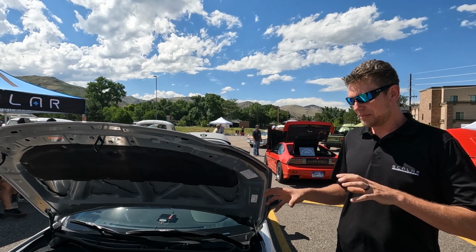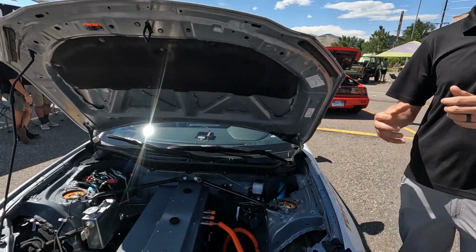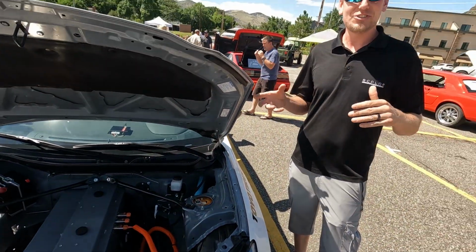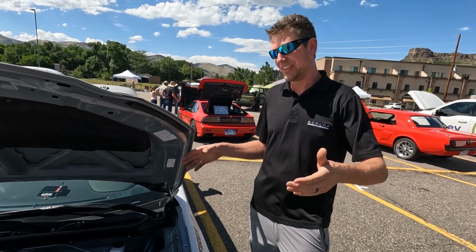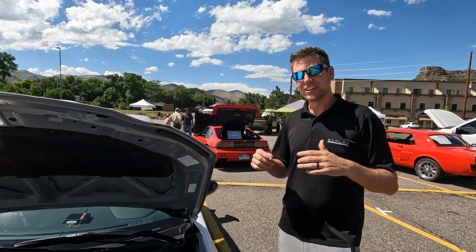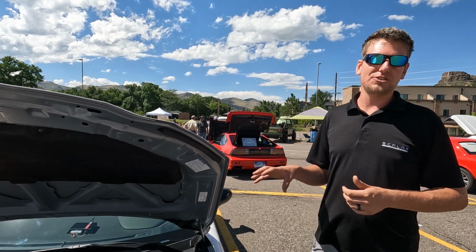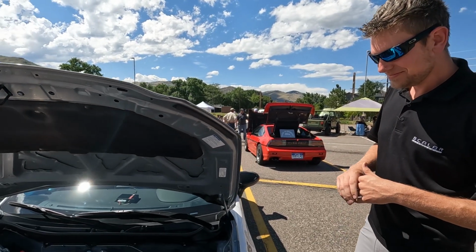It was a bit of a challenge because 800 volt is so new. For example, our DC to DC: there are tons of 400 volt DC to DCs that you can get, but try and find somebody who makes an 800 volt DC to DC. It was super hard to find. We had a big wait time to get it. The entire time we were building the car, the DC to DC was the last component that we could get. Luckily, Cascadia made inverters that handled up to 800 volt. There were some challenges with choosing 800 volt, but we really wanted to achieve 800 volts with this car.